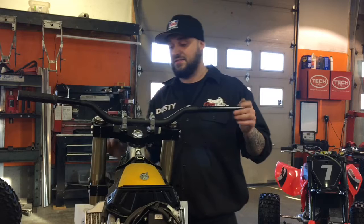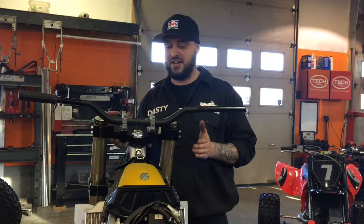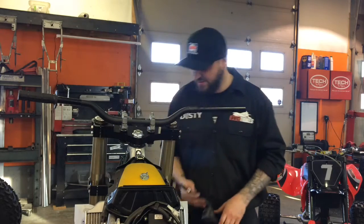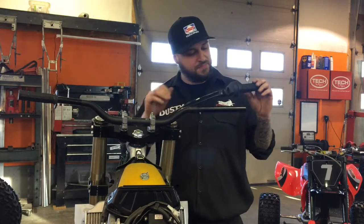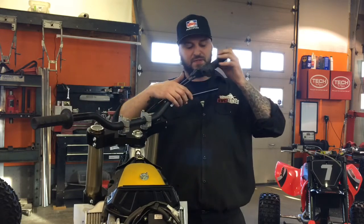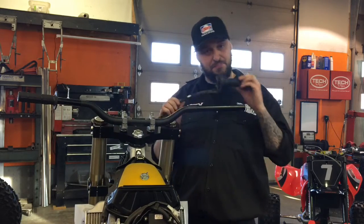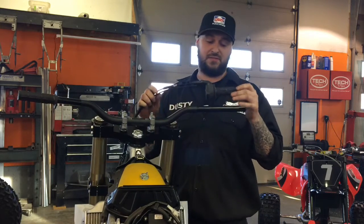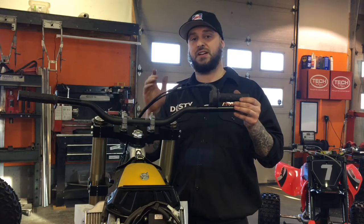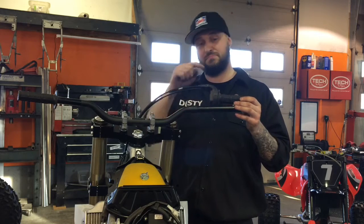So, common rookie mistake just made. And I did it to teach you guys so you don't have to do this over again like I'm going to show you. You go to take your bars, and you've got the grip and the throttle. Oh no. Can you believe that? All that work, and it's got to come back off so you can put the throttle on first. So, lesson learned. Don't do what I just did. Do what I'm about to do. Put this on first.